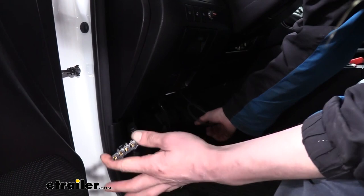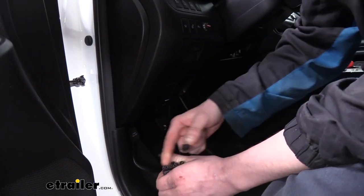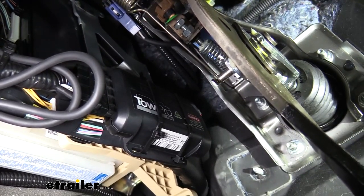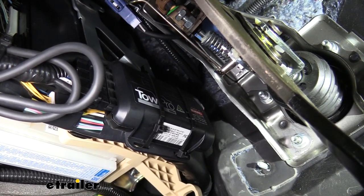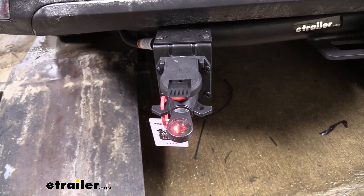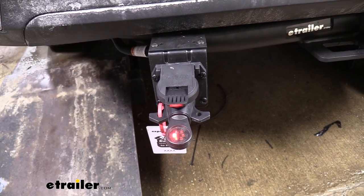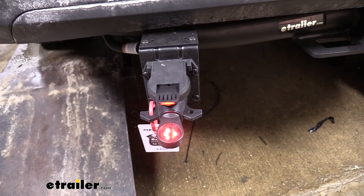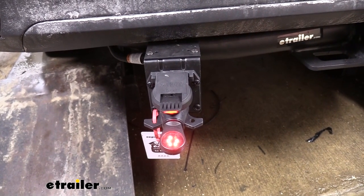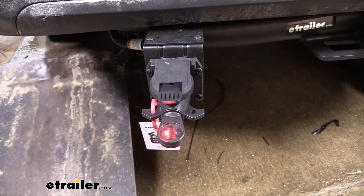Now we can take both wires — the large four-pole that plugs into the module and the small one that comes from our switch — and plug them into the module. This plugs into one side and that plugs into the opposite side. The four-pole plugs into the front side and the small one into the back. Fold up the wires and zip tie them out of the way so your feet aren't hitting them. We've gone ahead and plugged in our tester — you can also plug in your trailer, but I recommend a tester. Make sure your seven-way is fully functioning: check left turn signal, right turn signal, tail lamps, and brake lamps. You should also see one light always illuminated — that's the charge line circuit. We also hooked up reverse, so pull it into reverse to verify the reverse light circuit. And lastly, check the output for our brake controller by pushing the manual activation.